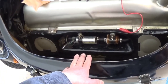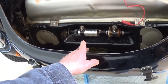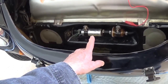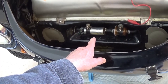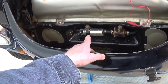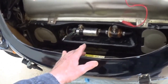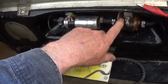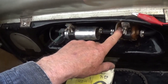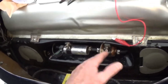You want to double and triple check — with these rotor-type fuel pumps especially, you don't want to be pushing five or six pounds of fuel pressure into those carburetors. Also be careful of things like this clamp here — it's tightened down so much it's actually deformed the little filter. It's got a nice pre-filter though.